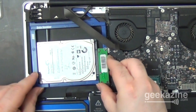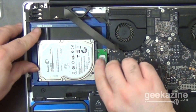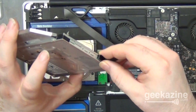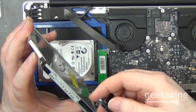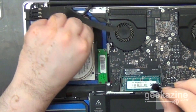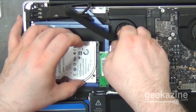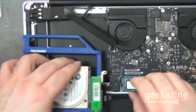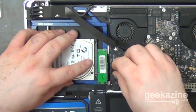Now, in the Data Doubler, I bring that in and I'll bring that right into the hard drive bay just like that, watching out for that wire. And it sets down. I did forget to do one thing back at the hard drive — we have this piece here. If you pull this off, these are SATA connections, although the power looks to be a little bit smaller than a standard power SATA connector. But this little piece right here is what we need. So we put the DVD drive back, bring this back out, and then take that piece and set it right in there. Now we've got the ribbon cable ready to go. We'll put that right back in, minding that cable once again. And we're good to go.